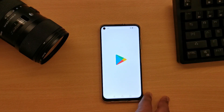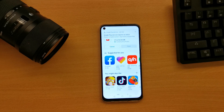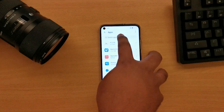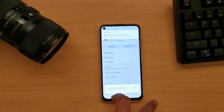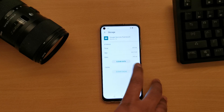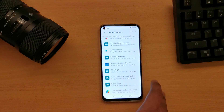Step 16: Once restarted, check if the Play Protect notification has stopped. If it hasn't stopped — as in my case — go to Settings and uninstall Play Service. Then go to Google Framework again and clear data and clear cache. Step 17: Go to the downloaded folder and install the last app, number 10.